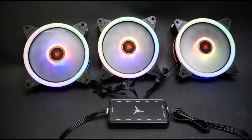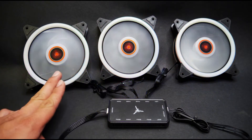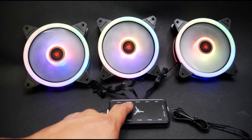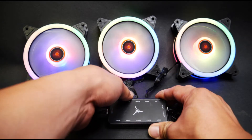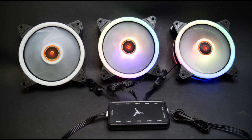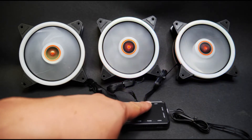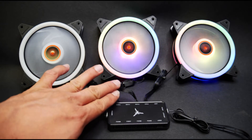Going back to the fans themselves — once the system is working well you can see all of them are lit. But if one is not lit up, there's a trick to these fan controllers. You can see the labels here: fan 1, fan 2, fan 3. If by any chance one is plugged into fan 4 or another out-of-sequence slot, you can see it's not lighting up. It needs a fan in each socket to pass the signal through to the next one. If there is a break in the chain, it won't pass the signal to the rest.